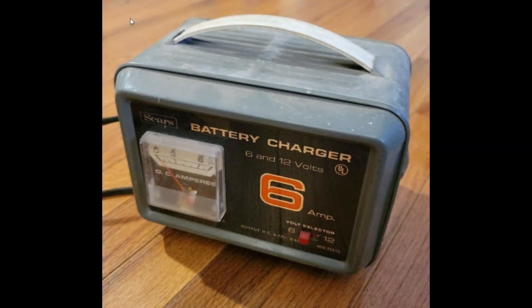After reading that, and I knew that it was lying, I pulled out my old Sears Craftsman 6-amp manual battery charger that I've owned for 50 years. The thing about these is it doesn't care what the condition of the battery is. You hook up the clamps, set it to 12-volt, turn it on, and it will try to charge it. What I ended up doing was I let that manual charger sit at 1-amp charge — that's what the needle read — for three days. Nothing happened for the first couple of days. The third day, the resistance was finally worn down internally, and it started to charge.